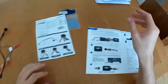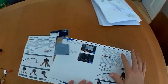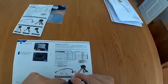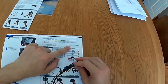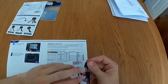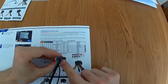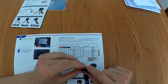The next thing to do as per the instructions is to prepare the patch lead. I had a quick look at it off-camera to understand it. You've got the pin configuration here to make sure you get it right — 'reserved' just means there isn't a wire in that pin. So pins one, two, and three have no wires — that confirms you've got the right orientation.